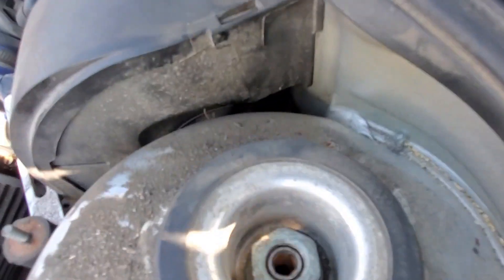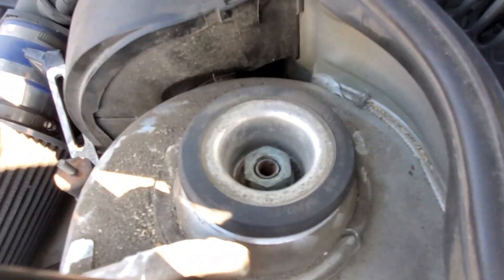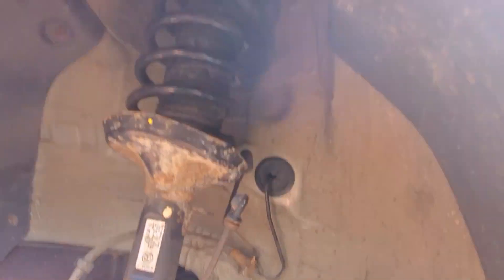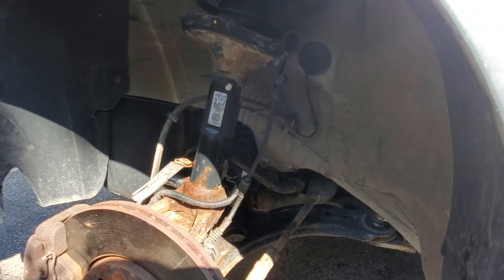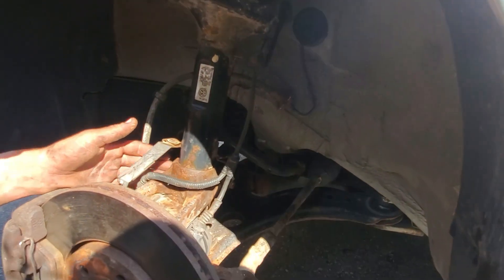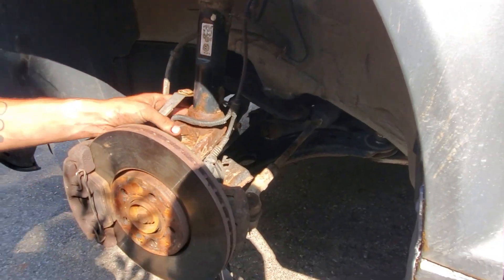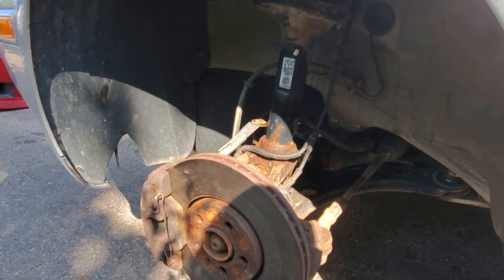You can see the bolt hole right through, and on top we got it tightened down basically flush with the top of the nut. Decent amount of thread — shouldn't be going anywhere. We'll check on it. I'm going for max lift so doing the bare minimum compression. We'll put the brake line and ABS lines back together and the side's done. Make sure you spray penetrating oil — makes life easy. We'll tighten that nut up, put the tire on, repeat on the other side, then you'll get the final reveal — lowering it down, seeing how it settles, taking it for a drive, and before and after clips.